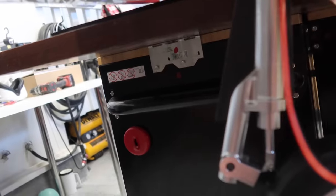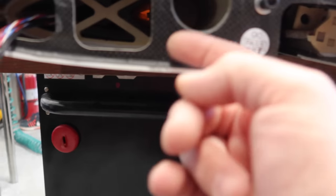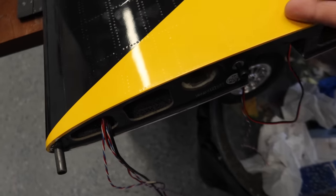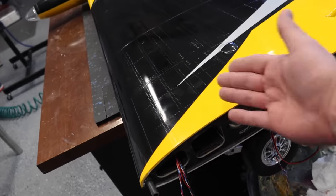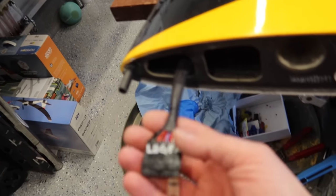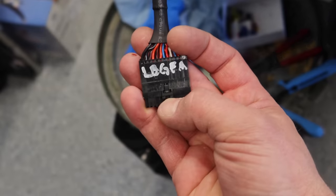The reason you need to cut the bellmouth is because once you attach the pipe to it, the pipe will stick out too far. The manual says cut it at about hole number four, so right about there, and then it sits properly. For the wing wiring, this is our brake wire and our flap wire running on the underside of the wing tube where there's a lot more room. We're actually running it back underneath the tube on the other side of this rib and then forward — it's a bit of a pain, but it's the best route.